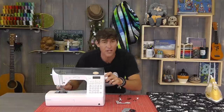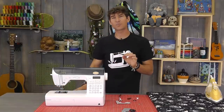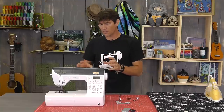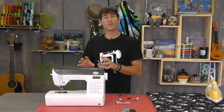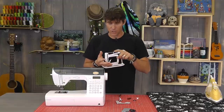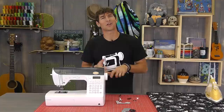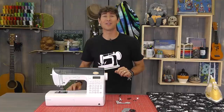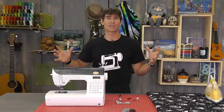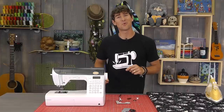One of the things I don't ever do is use those cans of spray air. The cans of spray air are actually CO2-propelled, and after every three or four bursts it shoots moisture in there. You don't want to spray that moisture into a camera, a computer, or a sewing machine. The only places I know to buy that spray air is a sewing store, a camera store, or a computer store — so I'm recommending you don't. But if you want to take this outside and use the giant air compressor that's out in the garage in your other workshop and blast it, I am cool with that.